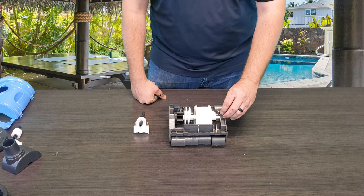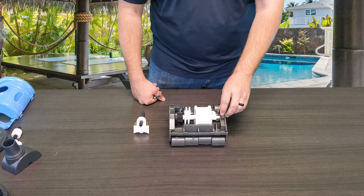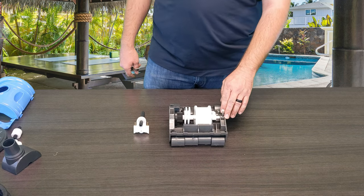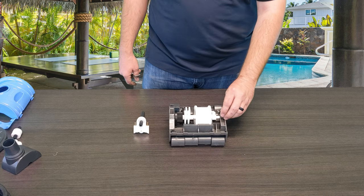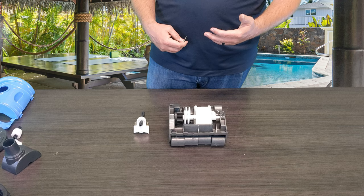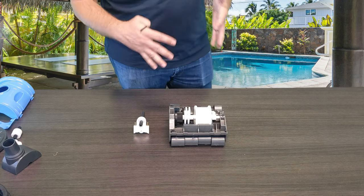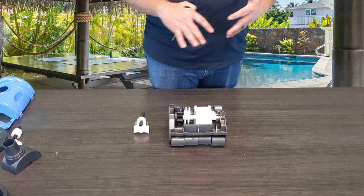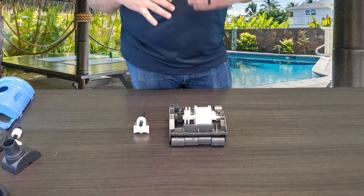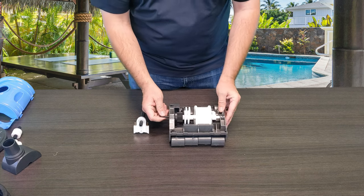You don't need to remove this screw entirely. You don't want to constantly keep loosening or removing and installing it, as it's going into just plastic — eventually you're going to ruin the screw hole and not be able to tighten it down at all. When you're going to start replacing stuff, make sure you replace stuff in pairs so you're not disassembling the cleaner often, and so the original parts stay original. Once you've loosened it, push the axle all the way through.